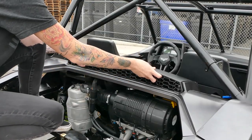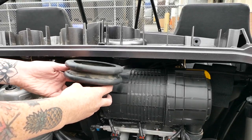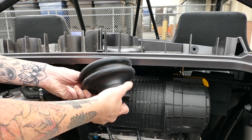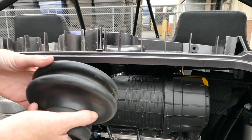Now slide off the cover. It was kind of hard to see on camera but how I removed the air inlet boot from the vehicle was I pushed it up, pushed it over to the side, pulled it down — which I found easier to do from the top — and then pulled it towards myself.